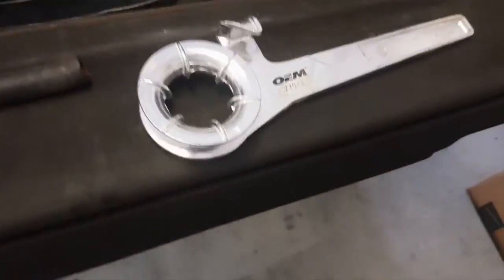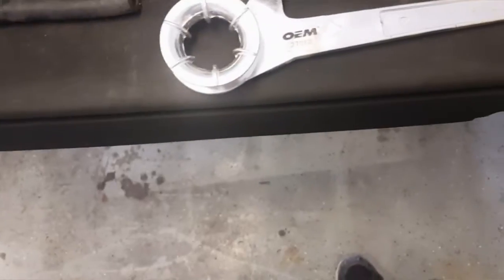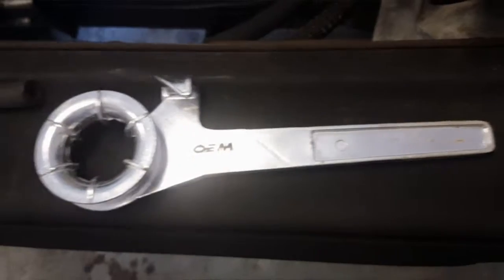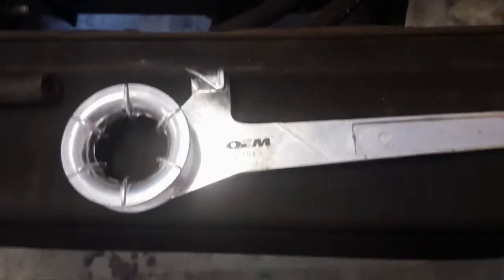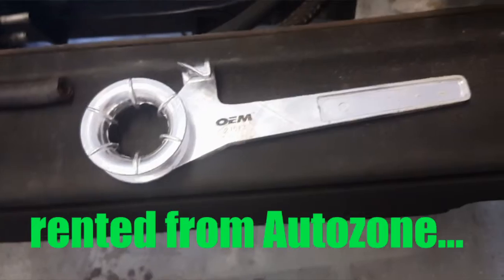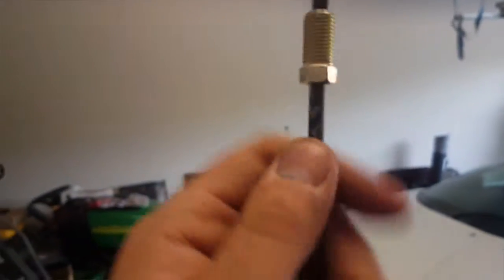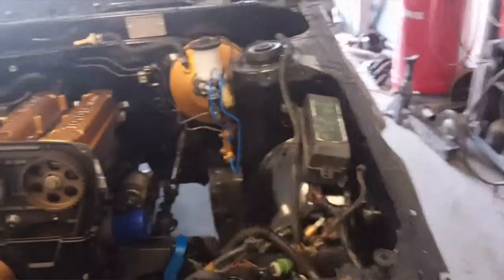Some of you may know what this is — it's a metal tube bender, just for small lines like brake lines and clutch lines. We're going to make a line. I bought 70 inches of this from AutoZone; it's got the little fittings on it already. This fits on the clutch master cylinder — we're going to start it here and run it all through.